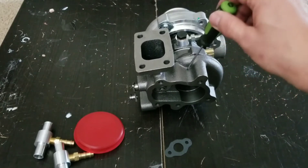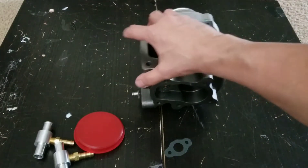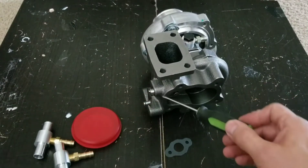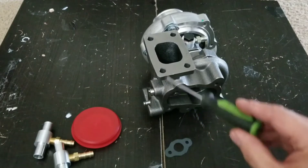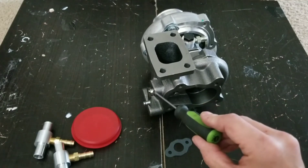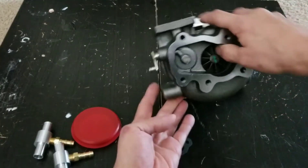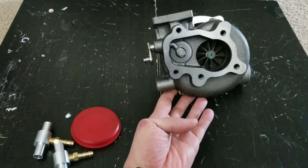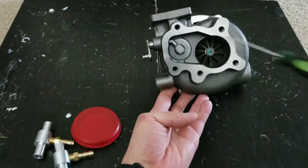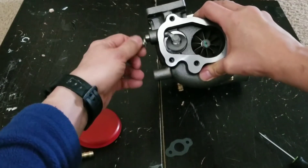Let's go down to the specifics of why I said it's well made. You see this part right here — the wastegate bushing. In the past I read reviews where this bushing was missing, and after a while the wastegate did not sit properly inside and started to be sloppy. Well, looking at it now, it seems like the whole assembly is how it should be — maybe it was an improvement.